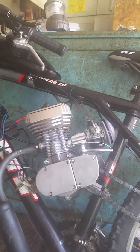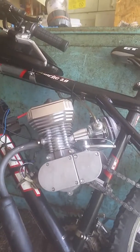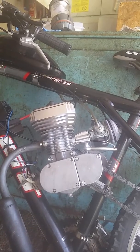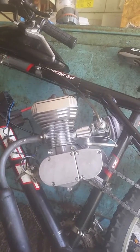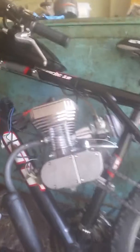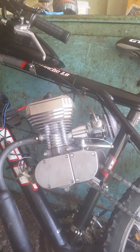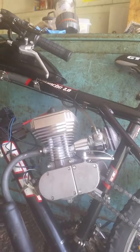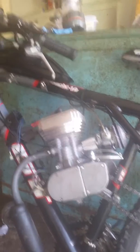So if you're new to motorized bicycling and you want to go fast and get a window piston and a reed valve, I recommend getting an OZ reed. Don't get the Reese reed. There's actually a bigger reed too, but I can't remember the name off the top of my head. The bike runs great. I can jet down to 62 and it will still run. Once I go below 62 it starts to lean, and if I go to 67 the engine bogs down. So 66 is where I think it runs great.